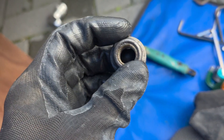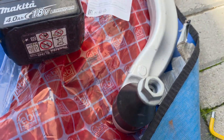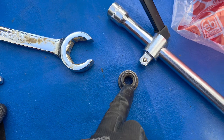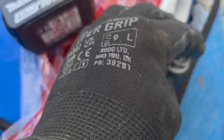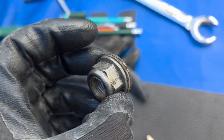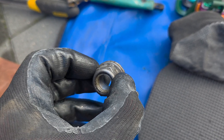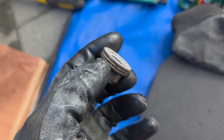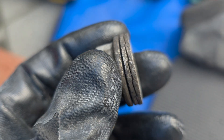That nut is actually 22mm and it's got a built-in washer on it, which is obviously the original. The replacement part doesn't come with a washer. It's recommended in the Tesla service manual that this nut should be replaced. The washer is a separate piece and the way it's been machined - there's obviously a reason that's on there.